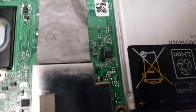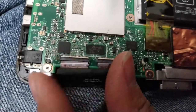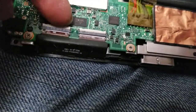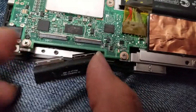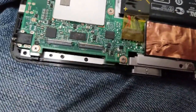There are latches here — make sure they're up when you're replacing it. Normally the latches will be down. Use your nail or something to pry them up; they'll flip up like that. Once you flip them both up, just pull the cable out. Normally you'd pull that out before you take the digitizer out, but since it's already broken it doesn't matter — you can just cut that cable.